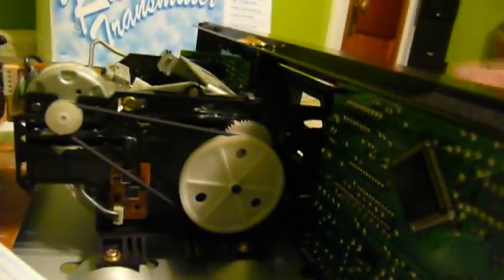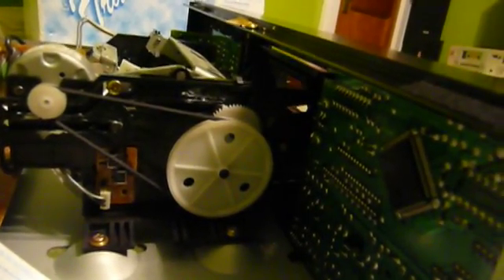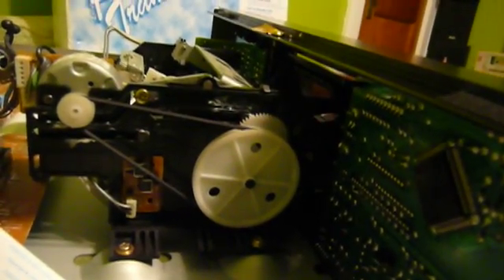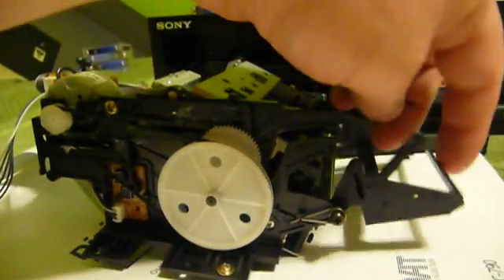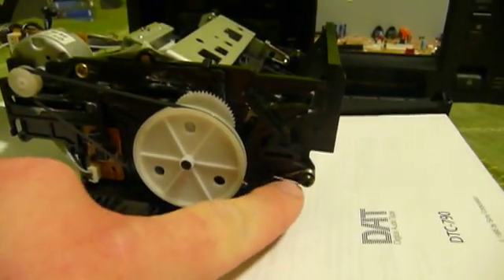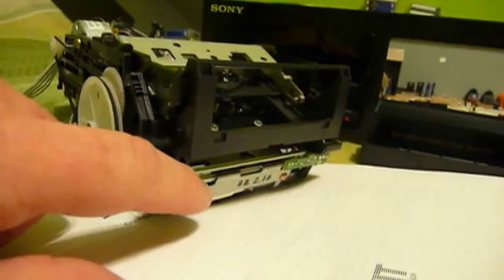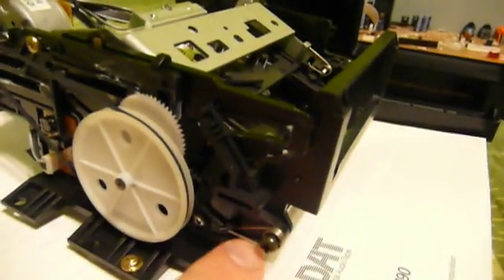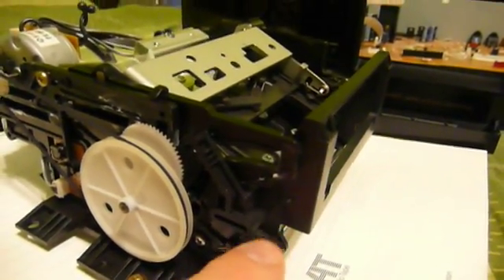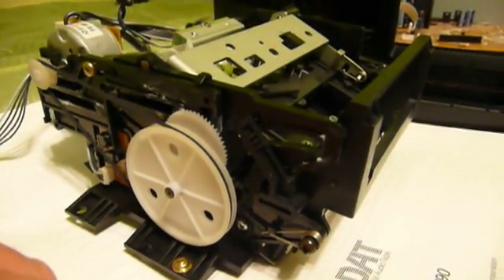This front door here, which you can see me playing with in the background, was actually pushed up into this area. And it had simply been popped out of its mating set of pegs on the bottom. For the falling-open problem, that's a little bit different, and I'll have to get the mechanism out. With the mechanism out of the unit, you can see what went wrong and why the door just flaps open in the breeze. There's a little spring down here, and this part of the spring has come free — it plugs into a peg right here, and that got wrenched out of its connection over here, and this thing just got pushed up and over and out of the way. Luckily, no lasting damage was done, and this deck works perfectly otherwise. All I should have to do is hook this back up on this little plastic protrusion, and the basket should work properly when I put the machine back together.